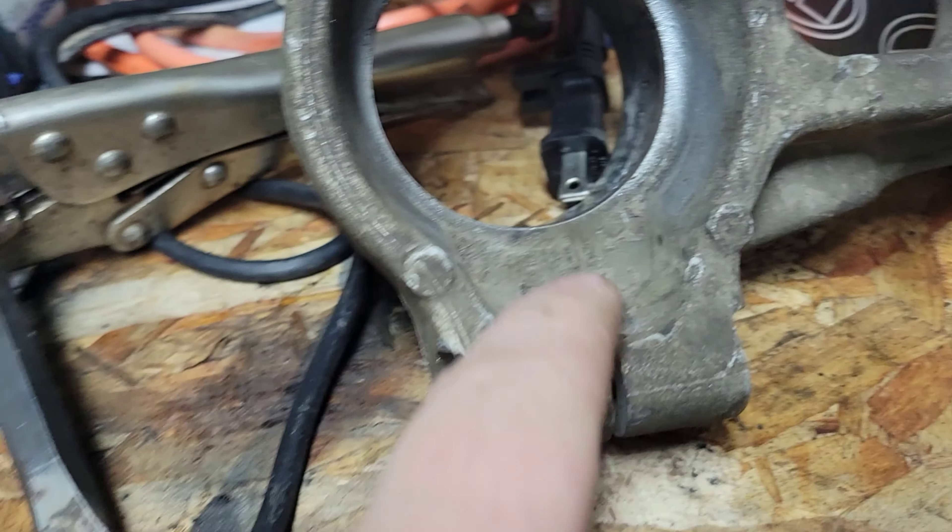Take your new seals — these guys right here. Again, talking about part numbers — that's going to be part number 154-3611. Now these guys, when they go in here, they actually do stick. When they wear out — which more often than not — that's one of the things I hate about this design. It's not this steel piece that fails, it's actually this stupid rubber piece around it. Which, to be honest with you, it would probably be easier for me to find that. But if I just put a regular seal on that, I'm not so sure it would actually function properly. And there we go — that is one side right there with the bushings and the seals in them.